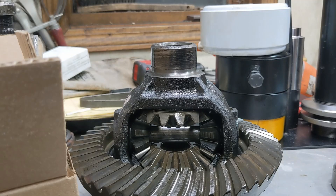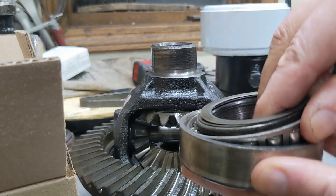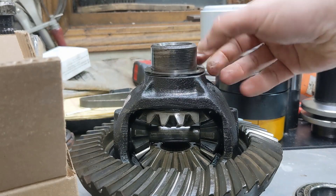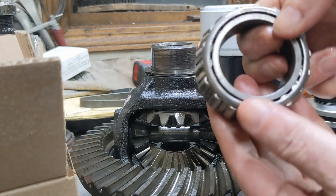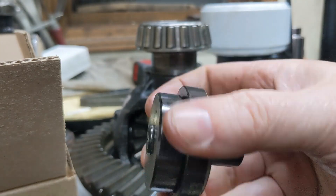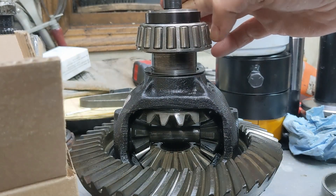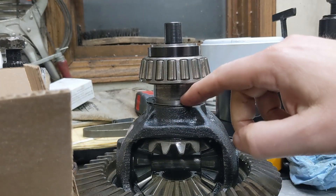There's not a lot of room over at the press so it's a little easier for me to show you how to set this up here on the bench. This is the orientation these came out — the shims, then the bearing, then the race. But these go on this way. So you're going to take the shims that you had, put them on, and then take a bearing — I'm going to be replacing it with a new one, but just for demonstration — with the cone pointing outward. Then I've got a pair of seal drivers from a kit. I took two of the rings from that kit and put it right in there, and then push on the press right here to push that down against these shims.